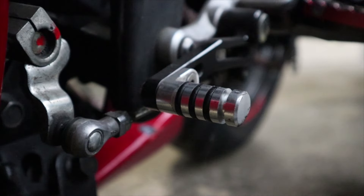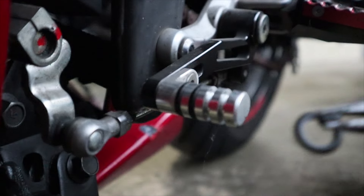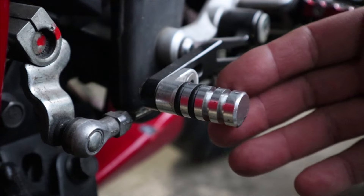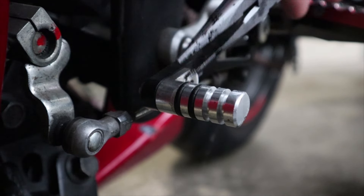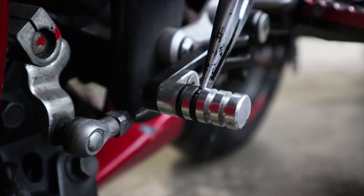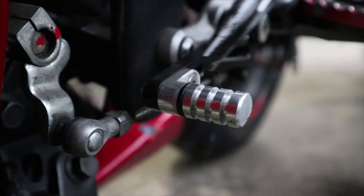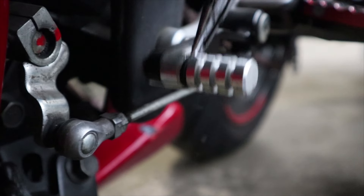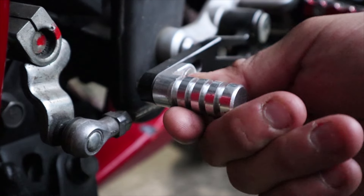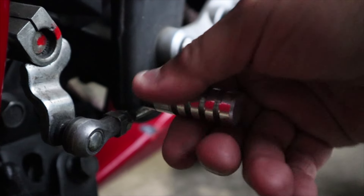It's a little bit of a difficult challenge — but there we go. Just pull them out with the pliers. I'm trying to get a good shot with the camera, so forgive me if things get a little blurry. Just grab the pliers, pinch it, and pull it out — most likely they'll just break out because they are brittle. If you happen to have one that's still in decent condition, might as well take it out and replace all of them with brand new ones. The grooves inside look fairly good, so no need to clean it, though now would be the best time if you want to.